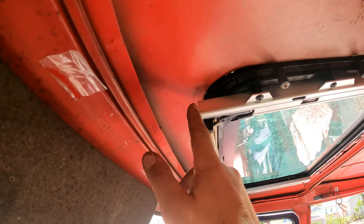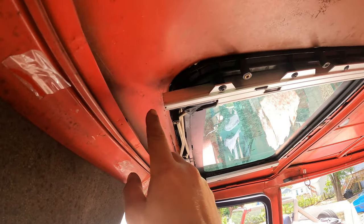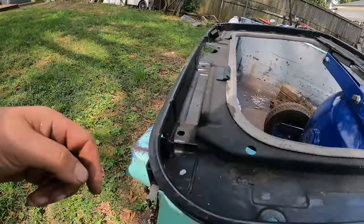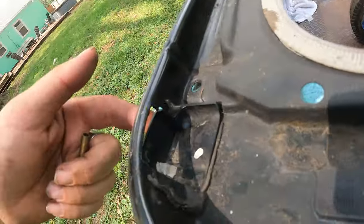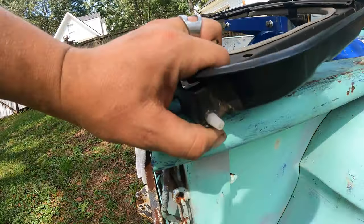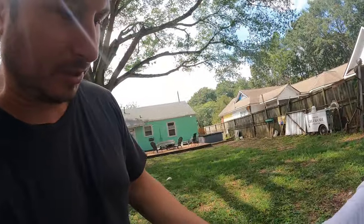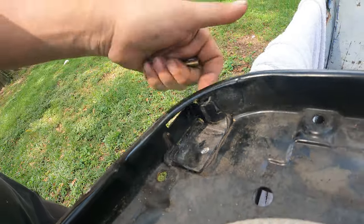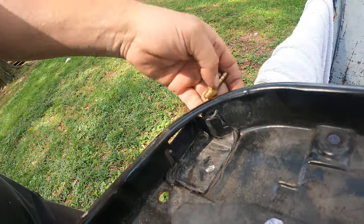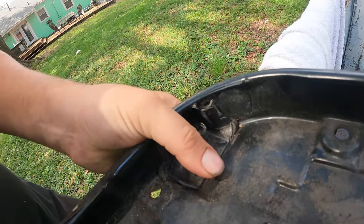Let's get technical. Here's the beginning of our track for our sunroof, and there's our front mounting hole for the pan that goes in here. In relationship, that's our front mounting hole. So our track actually goes to the edge of this little cutout square thing. The issue is this cutout square thing is a piece of plastic glued to our steel pan. This one is very loose, so it has to fill up before the water will actually run out of this little hole, and before it does that, it just runs all over the place.